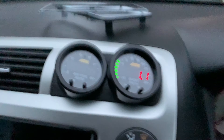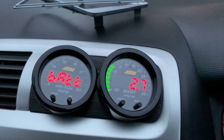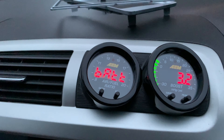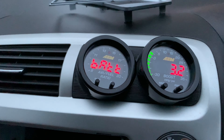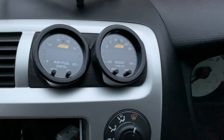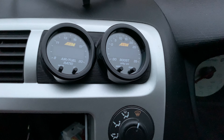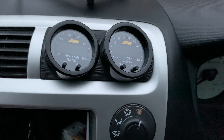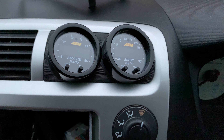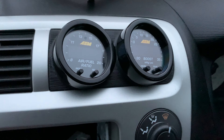Let's give it a test. What does 'BAT' mean? I've never got a low battery — it must have because that's flashing. It has been sat for a while. I've had the boot open for like three weeks probably, which probably hasn't helped, and all the doors open for ages. So it's drained, but that's easy enough — just get the jump leads out, give it a quick jump, problem solved. It does work because it lit up, so that's good.